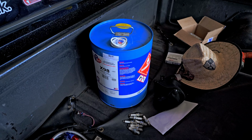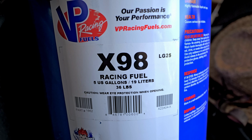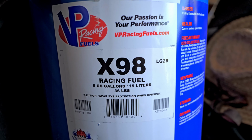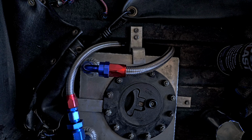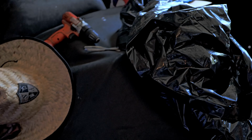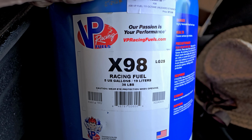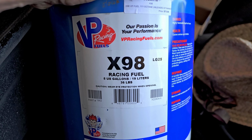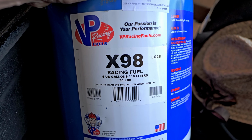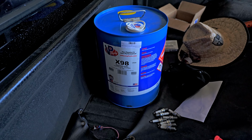That's just my theory. So basically, I think from now on, when I'm spraying nitrous, I am only running X98 in the enrichment, and if I step up more, I'm going to run X98 in both. The reason why is because then I'm only worrying about ethanol and nitrous and not gas mixed with ethanol. One thing I've always thought is, like, ethanol is too expensive.